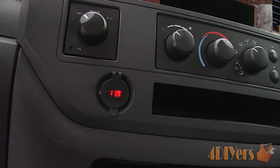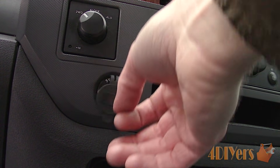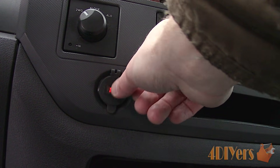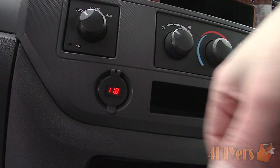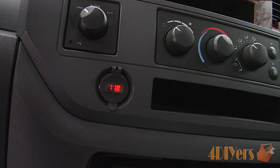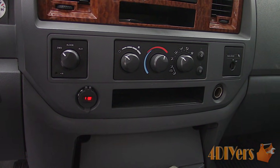Here you can see its operation. The rubber cover has a tinted transparent window so the voltage can be viewed while the USB ports are protected. Depending on your vehicle's design, make sure you take measurements on the port you're considering purchasing to ensure it fits. There is no need to add a fuse for the new port as this circuit is already fused by the factory.